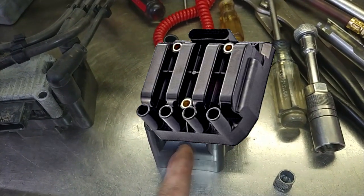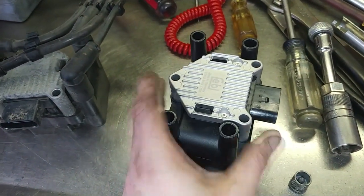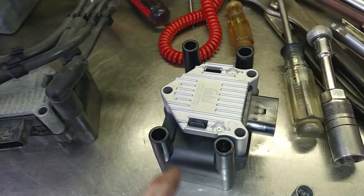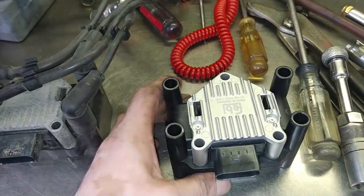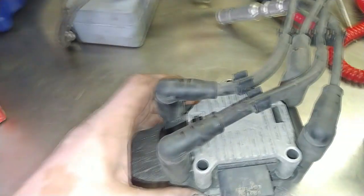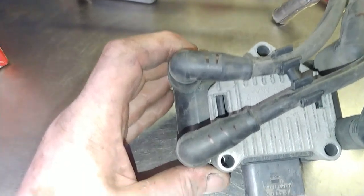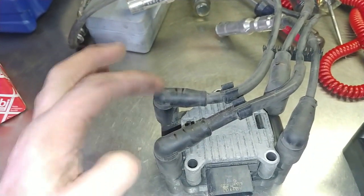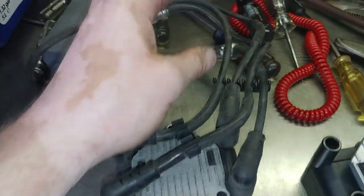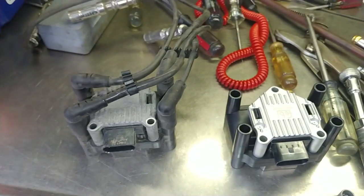On later styles with sequential ignition, you've got four towers in a row with four separate coils, even though it's one coil body. With those, you cannot swap ignition wires around because those spark plugs fire individually. So again, no big deal if number two is on C and number three is on B. If it makes you feel better, you can swap those two around as long as the overall length of the wire still reaches. Sorry, I hope I didn't confuse anybody.